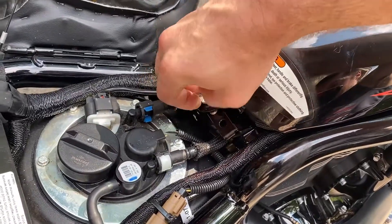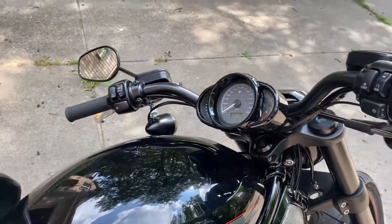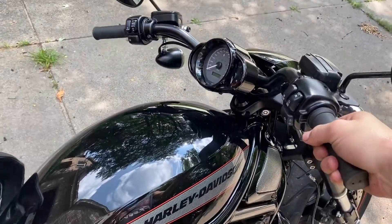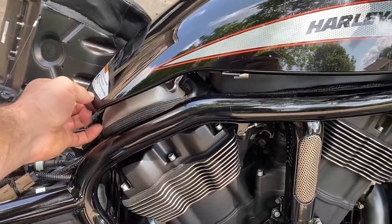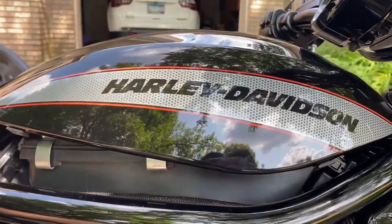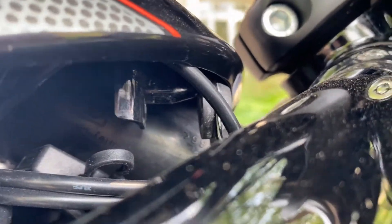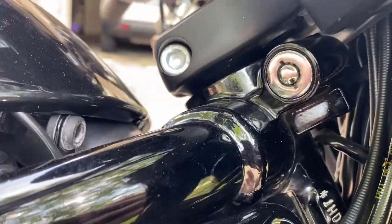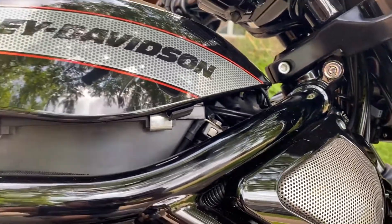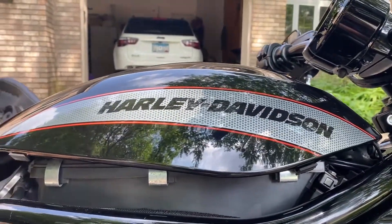On this Night Rod we're going to lift up the seat and then turn this clip counterclockwise a quarter turn and you should be able to lift it up. Straighten out the bars — this will help just a little bit. Carefully lift on the back where we loosened the clip, and at the front you'll see two tabs. Wiggle and pull towards the back of the bike — there are two little metal tabs, one on each side, that go into rubber grommets. Once it's slid back, carefully lift the air box cover out of the way. Be careful not to scratch it.